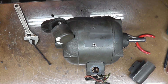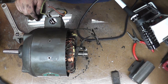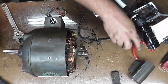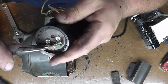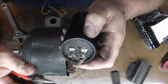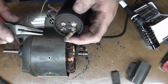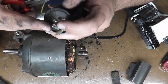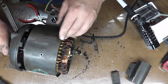I got the bell housing off. I had to unsolder the capacitor, and when I did that I found that the bleed resistor was never soldered on the other terminal. It's not a huge thing — all that's there for is to sap the residual voltage out of the capacitor when you have it off, so if you go to touch it afterwards you don't zap yourself.